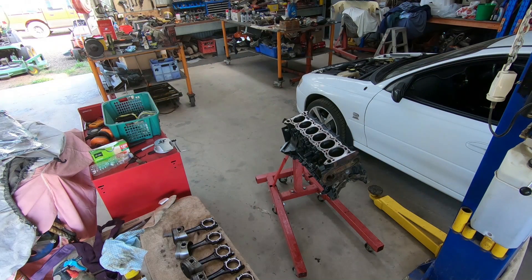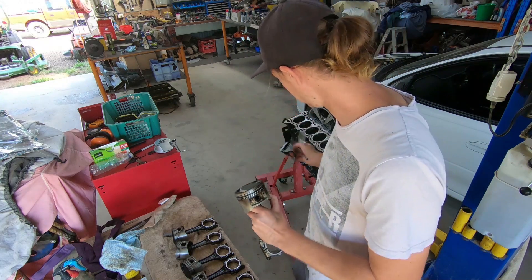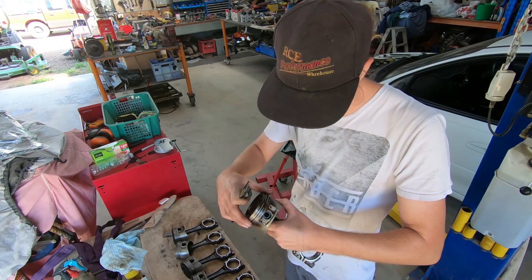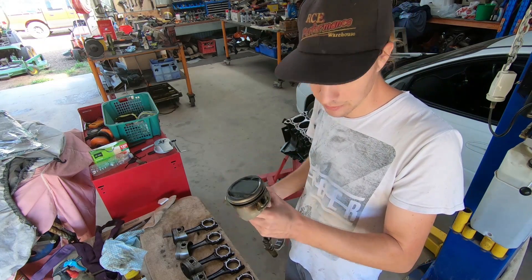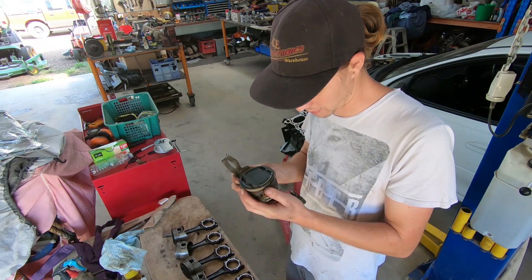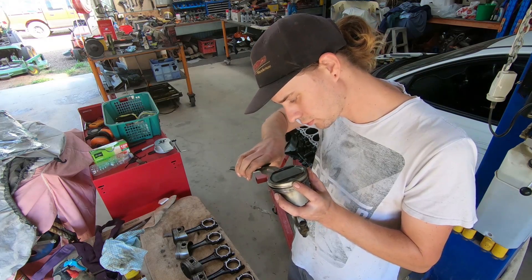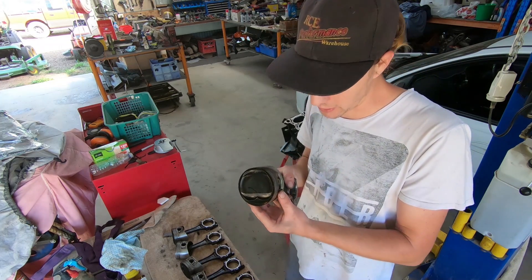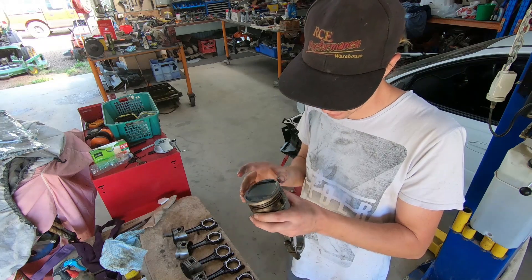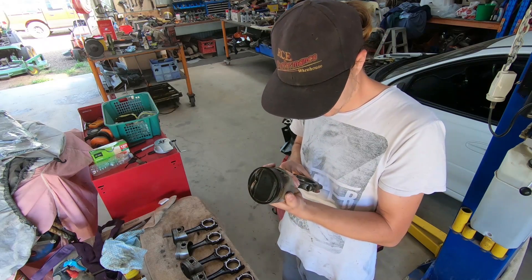First I'll grab the rings off the pistons I won't be using - these are the flat top pistons that came out of this motor. I'm not using them because I'm using dome tops for the extra compression. However, these are the rings that came from these bores so these are the rings I'll be using. They still look like they haven't done much work - I dare say this engine was ringed when it was rebuilt. I always like to pay very close attention when pulling things apart because even trivial things can tell you a lot about whoever put the motor together.